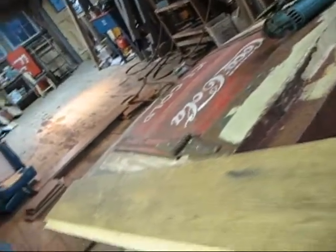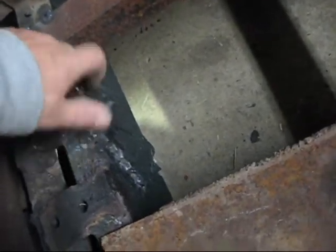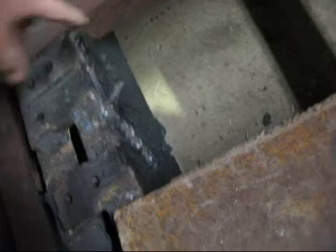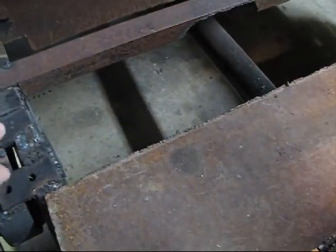I'll explain the technology of my madness here for you. Having done the welding, the next thing to do is put these boards in. I'm going to take my big ugly grinder and grind off the rough edges, then sit this piece down in there. I'm going to put a bolt through this piece of oak — mount a big nut inside the frame that a bolt can go through, all the way through, and put a nut on the bottom side. That's what's going to help hold the body down on the frame — the wood itself will be bolted to the frame.